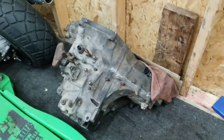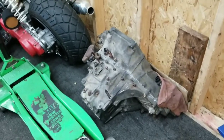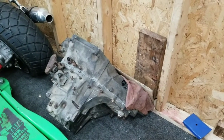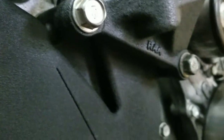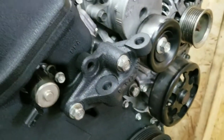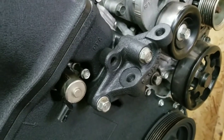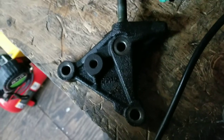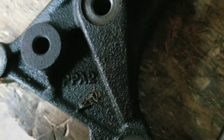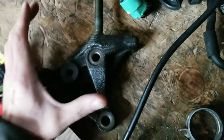Let me get back to cleaning and starting to paint. Compared to this CRV transmission, look at the difference. So I painted this post mount in wrinkle black, just to find out it's absolutely not the right one. Let me show you the correct one - this is the one you want for a K-Swap. It's the PPA2, not the RAA - the CRV Element mount. That is the correct mount.